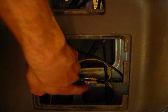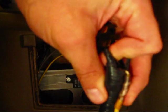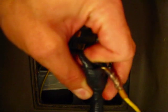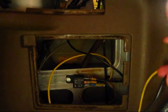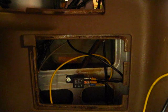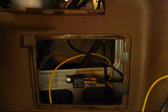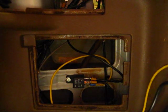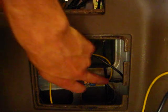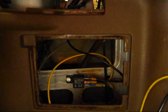Number 85 is grounded out and plugs into the top terminal. Number 86 is the bottom terminal and splices into the black and white wire of your original harness. This is on a 90 DSM, so the wire color may be different on your car — what you're trying to splice into is a 12 volt feed from your stock harness. This closes the circuit and flips the relay so that the power coming from the battery on number 30 goes through to number 87 and feeds the fuel pump. One wire from the stock harness activates the relay, and the relay transfers power to feed the fuel pump whenever it's activated.